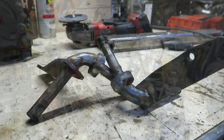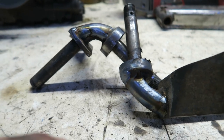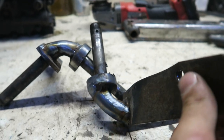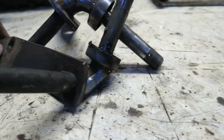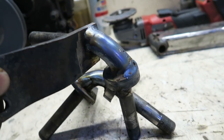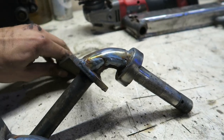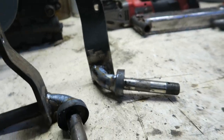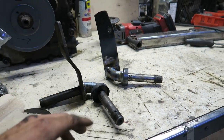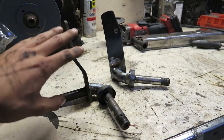So this is what I've been talking about with the bracing — fully welded all the way around that half-piece of tubing onto the spindle, nice bead all the way around. That's going to strengthen it up big time; we'll never have any issues out on the trails anymore. This is one of the biggest things you can do to your own mower — we do it to all of ours. We're also going to reinforce the tie rod tab further along once we get the whole rack and pinion set up.